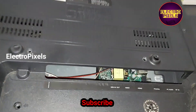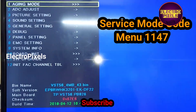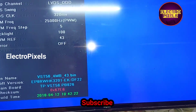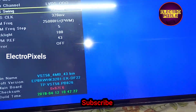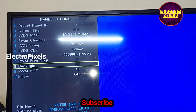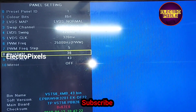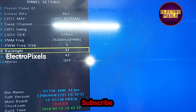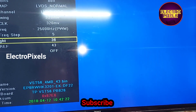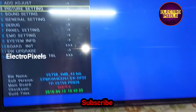After that, you need to enter service mode and reduce the LED backlight value. By default, the backlight value will be at 100. You need to maintain the backlight value between a minimum of 40% and a maximum of 60% for increasing the lifetime of the LED backlights. That's all for today — hope you liked this video.